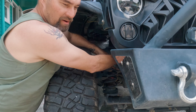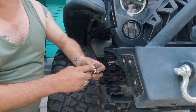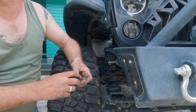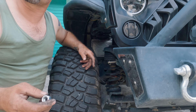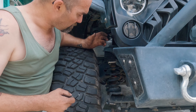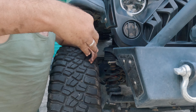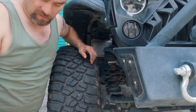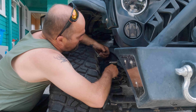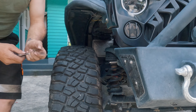This is the driver's side. If it doesn't thread into it — the whole point of having a nylock is it doesn't rattle undone. Otherwise that's what a castle nut is for — it looks like a castle, and it has a cotter pin that goes through the hole and lines up wherever the position is so it cannot rattle undone. I need to be able to fit it through so I can hold it still.